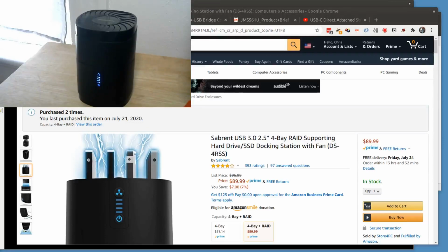So I think, for all intents and purposes, the largest drive you're going to be able to fit in here is a 2 terabyte, because I can't find anything over 2 terabytes that's 12 millimeter or 9 millimeter, whatever. That's not 15 millimeter. So the effective largest set of disks you're going to get in here is 4 2-terabyte drives. So that's 8 terabytes. And then, of course, in RAID setups, some of that is going to be chewed up by the RAID overhead. In my setup, I have 4 2-terabyte drives, and I get about 6 terabytes out of it.